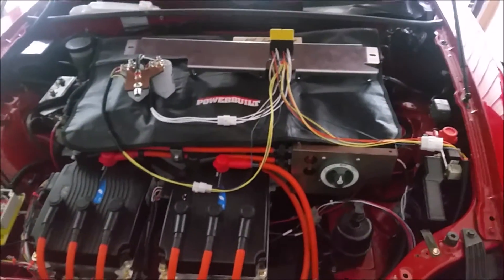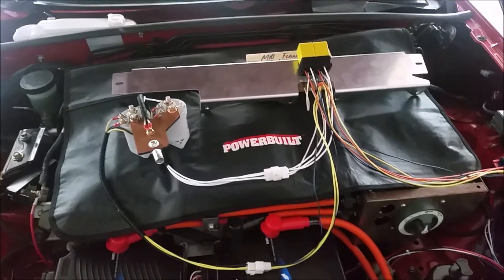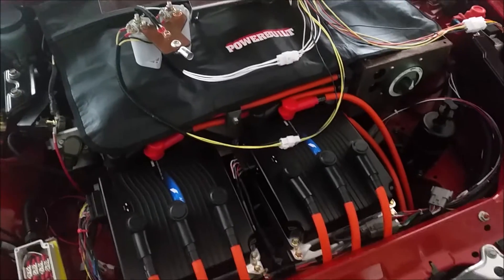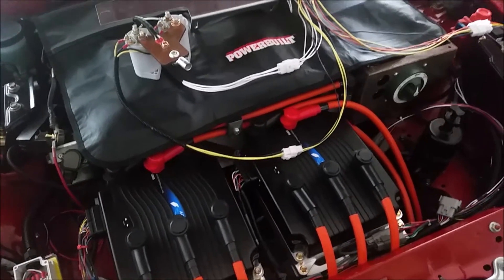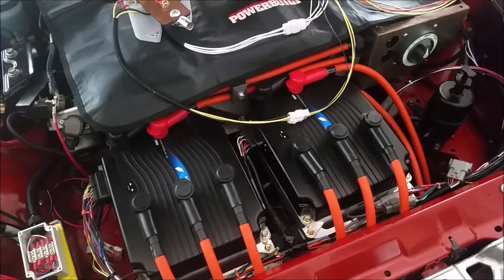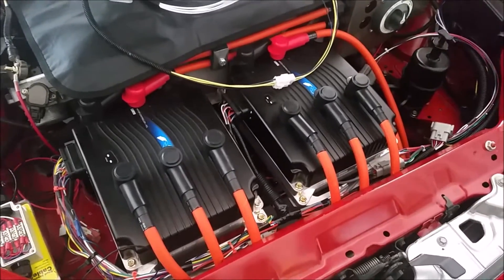I have already key-tested this. The left-hand or primary controller pre-charge circuit works fine. The secondary or slave pre-charge circuit isn't currently working. I'm not sure if that's because the secondary controller is waiting for the primary controller to say it's all good, or if it's something to do with my wiring connections. It could be that the pin 4 I added on my secondary controller may not be plugged in correctly. I'll go and check that off and see how we go.